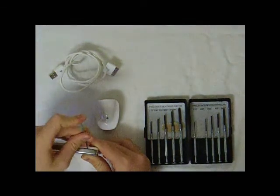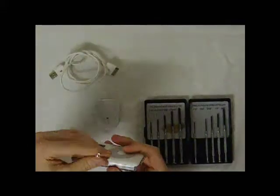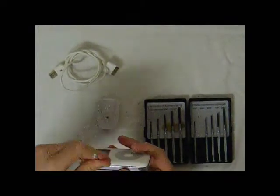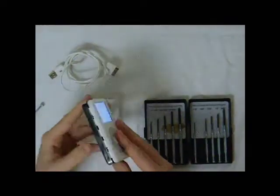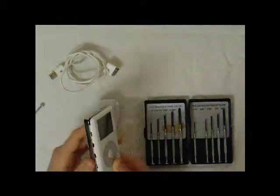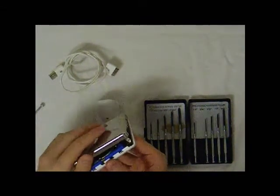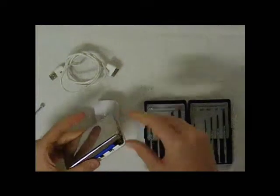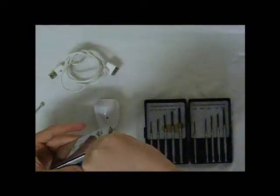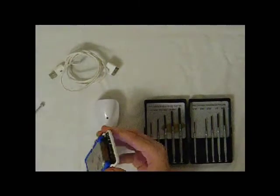Don't worry about bending, and then just lift it out. As you can see, there's a little gap. So put it in a little farther up and pull it out. Repeat that all the way up until the whole side pops for you like that. This opens like a door — it slides on one side. The back pops up, and it's got a ribbon cable attached closer to the side that you just opened at the top. That just pops right out. And then you set the back aside.